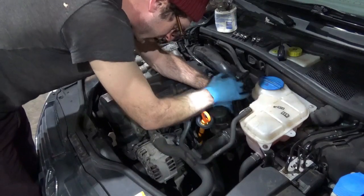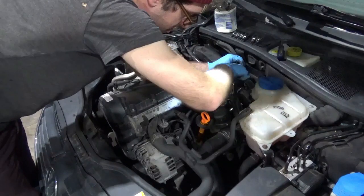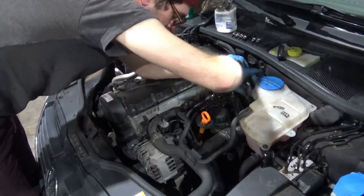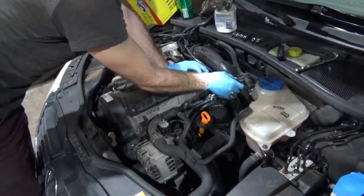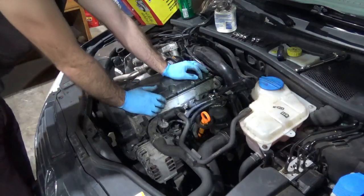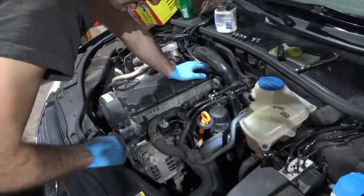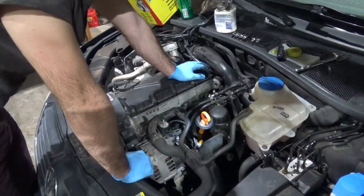What we used to do all the time for getting things together, especially on engines, like when some seal normally goes on rough over something else, or like installing that dipstick tube, is use a little foaming window cleaner out of the can. Even if it's in the oil, it'll just boil off. So we just use it like soapy water. Because it has a high enough boiling temperature, it'll just pass right through the engine. It's just alcohol and whatever.